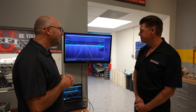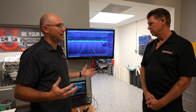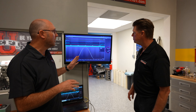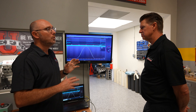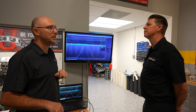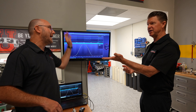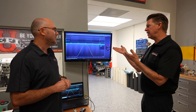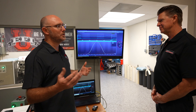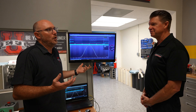So, what are we going to do next, Ben? If some is good, more is better. I wanted to prove a point that we could take the load off the spring and it would improve things. It improved it way more than I thought it would, which tells me we're going in the right direction. The fact that we've now gained 700 useful RPM of the engine — before we had a distinct change at 7,800 RPM, which also corresponded to where the engine misbehaved out on the racetrack. Now we have virtually no change all the way up through 8,500 RPM, because before it was unthinkable to go higher than that. It didn't even sound right. It sounds like it's a song now — you can just let it play out. Like a NASCAR engine. They don't feel like you should ever shut them off. I feel like if some is good, more is better — we should take some more load off the spring. We ought to turn the RPMs up a little bit more. How do we know where the edge is if we don't go out and find it? Let's go find an edge.